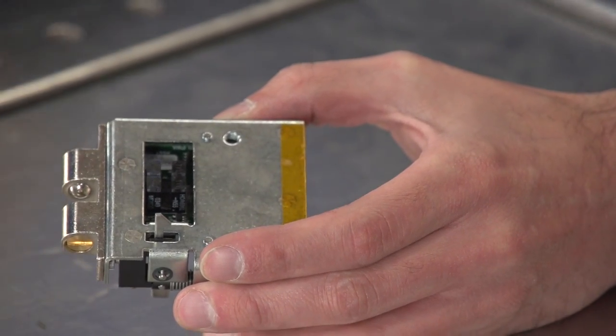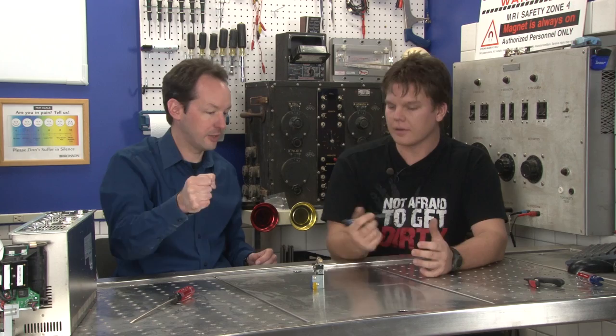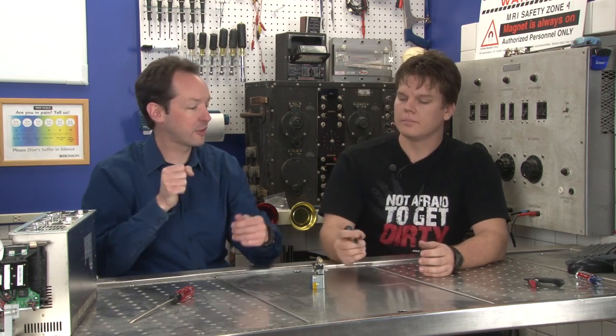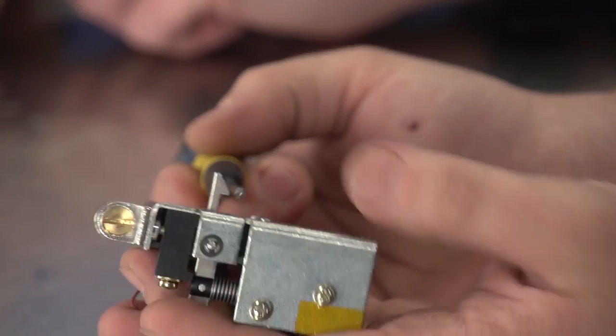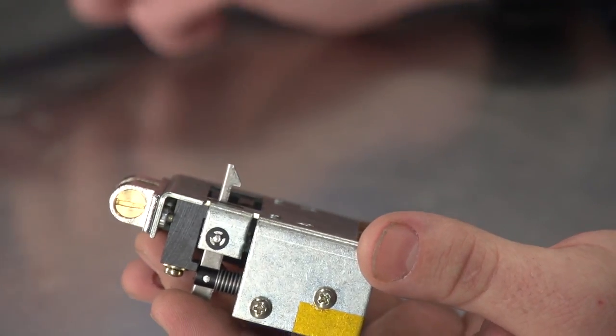But this is what I think this exists for: when you close the drawer, you get a good chunk. That's the purpose. It isn't just that it's in far enough. You push the drawer in all the way, it goes chunk, and it stays there, and it doesn't bounce back out. Because if you have a lot of pressure outwards on that little latch, your solenoid doesn't have enough power to retract. So your positive detent is going to hold the drawer far enough in that this can retract and then you can release it. So they use two different mechanisms to do this.